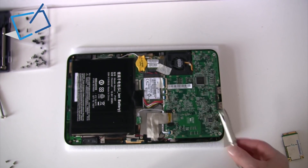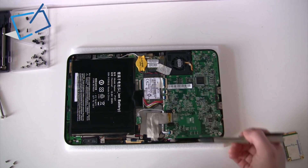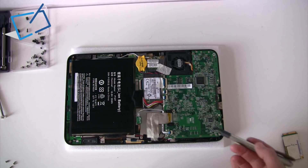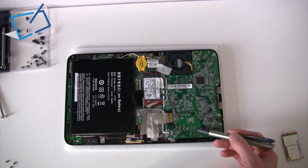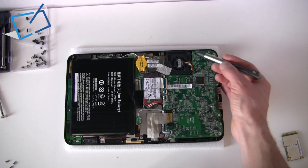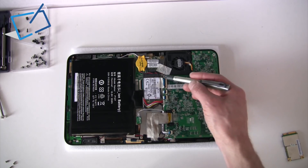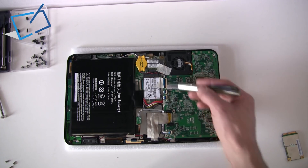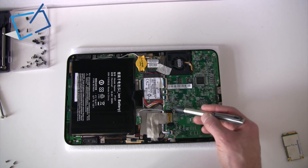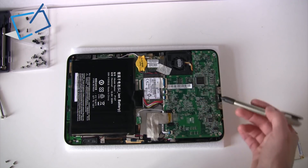Before we put the SSD in, we also need to change the RAM. That really can't be done easily without taking out the SSD, as the RAM is unfortunately on the back side of this board around where the pen is pointing. We needed to remove four screws — one here, one at this corner, one at the bottom corner, and one in the middle — and these screws are often covered with tape, so be very careful removing them.